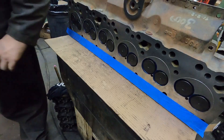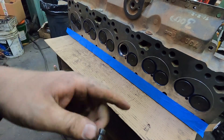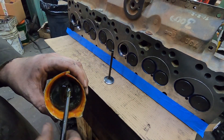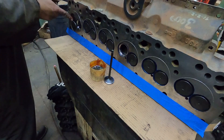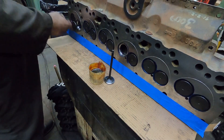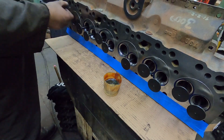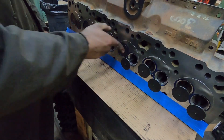Something else to note: these are all new valves, but when you go to put this stuff back together and it's dry, you need to lube it. What we do is use engine assembly lube so it doesn't drip off - the same stuff I use on the bearings. All I do is just roll your valve in it, get a nice gob on the end, and then just roll it as you're going in. That's pretty much it. You can use engine oil too, or any sort of engine lube for that matter. Lots of times when you buy an engine kit, you can get it with lube. Just make sure you lube whatever you're doing because you want to make sure it has some good material in there.